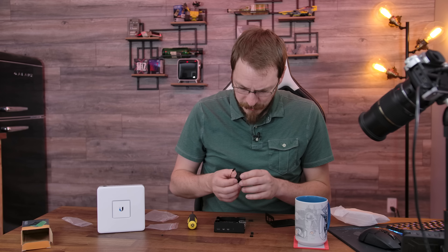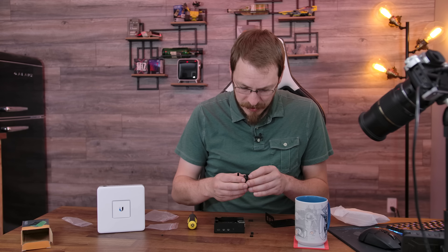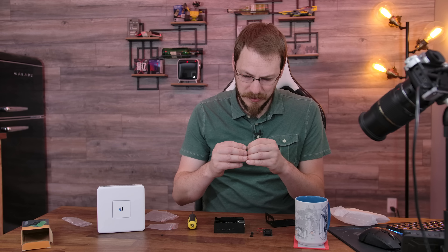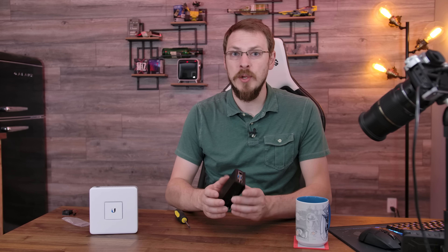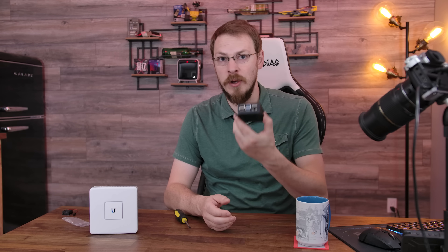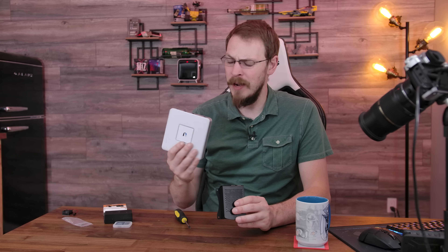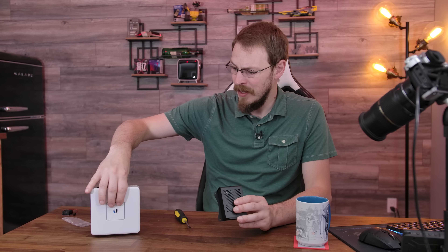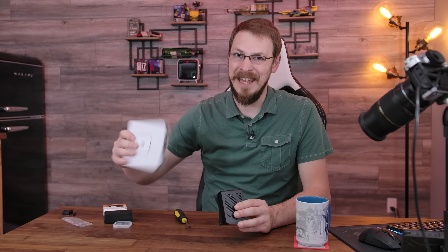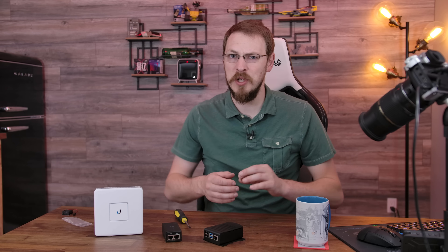This case does come with a little 20mm fan with a heat sink attached to it, but it's not going to quite fit on top of the CPU because the Pi hat extends just a little bit further. So I'm just going to put a little black passive heat sink on and call it good — we're not shooting for overclocking world records here, we just want it to run stable. When I go to do the final installation, I have an eight-port Power over Ethernet switch that I will be running everything off of, so the Raspberry Pi as well as the four access points I'm installing will be powered by that switch. For the OS, I'm using a Patriot 16GB micro SD card and running Raspbian Buster Lite, which is essentially the server distro of Raspbian.